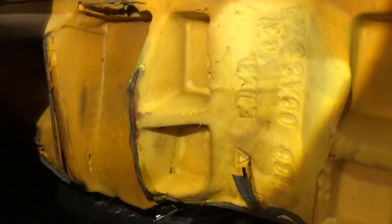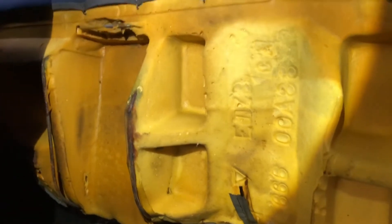The back seat is held in with a wire bracket on the bottom of the seat and then a bracket on the body. Essentially what you have to do is push in on the front of the seat and then pull up and you'll hear it pop out of the brackets. This thing reeks of cat pee. You can see the wire in the bottom of the seat is not in the greatest shape, but I think it's still usable — I'm pretty sure I can clean all that up. Let me get this out of the way and then we'll look at the floor.